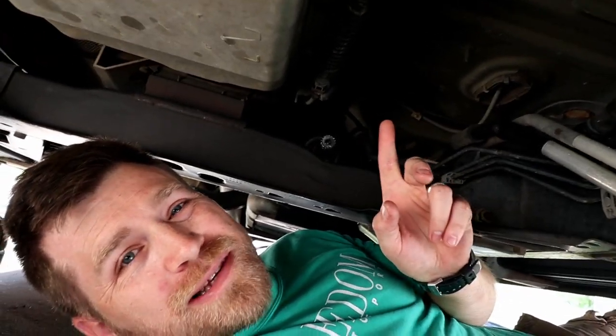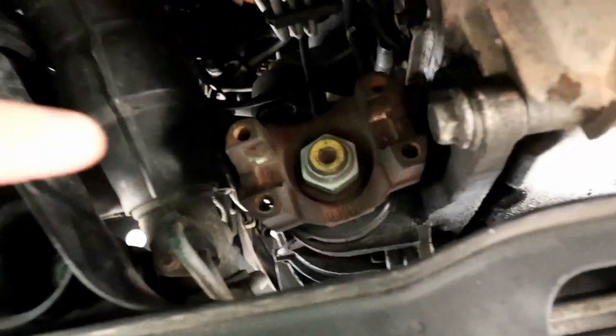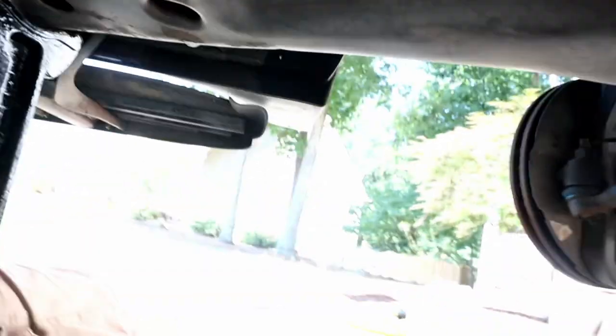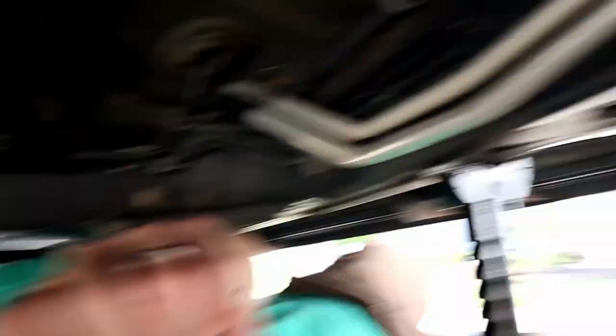As you can see, I've already taken out the propeller shaft — the shaft that goes from the transfer case up to the front differential. There's the yoke on the front differential; I've got that all taken out. Now it is just a matter of four bolts to get that differential unbolted from the oil pan. Hopefully that all goes well. And as I said yesterday, my hope is that I'm able to rotate it a little bit.